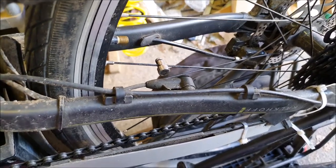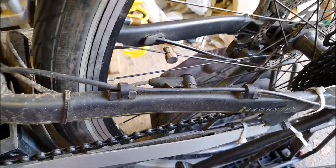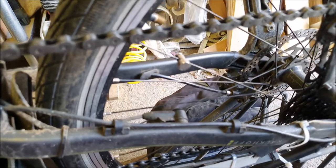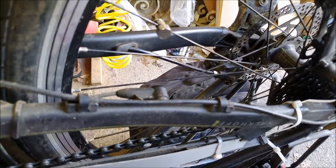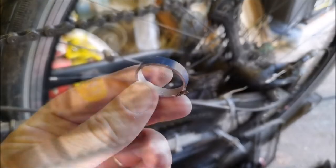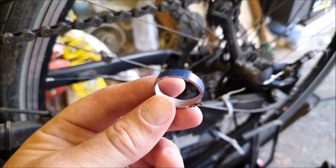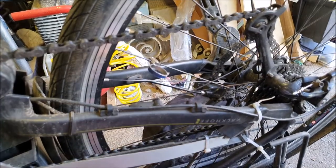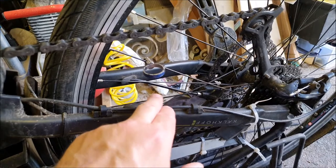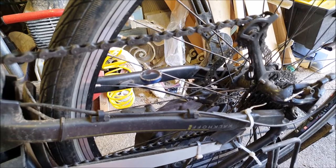I've turned the bike over to have a look, and there's the little magnet there - that just moves past the sensor and should pick up the rotation of the wheel. Someone did suggest that if we just replace that magnet, that might cure the problem. I know magnets can lose their magnetism over time, so I've got this bit of steel pipe off-cut to test if the magnet is still attracted to it. Oh yeah, that's pretty strong. So I don't know anything can go wrong with that really - it's either a magnet or it's not.